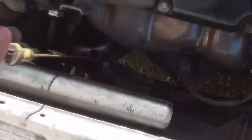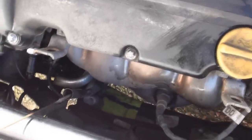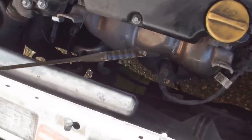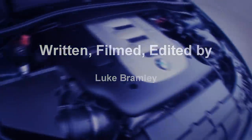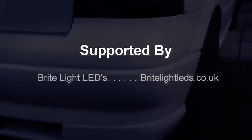We're going to turn it off and check the level. Pull out the dipstick, ignore the first reading and quickly wipe it off. The dipstick is nice and dry — pop it right down the tube, get a proper reading, and bring out the level. Perfect — didn't need to top it up; it's at the maximum. So we have one nice happy oiled-up car. Thanks for watching — if you've enjoyed that, please like and subscribe. If you have any questions about your car, please visit our website; the link is in the description.